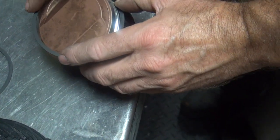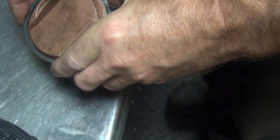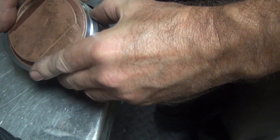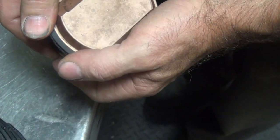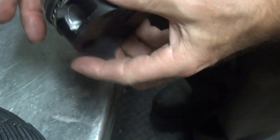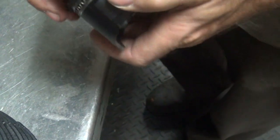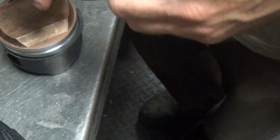So what you do is you put them in the groove over here, put your two thumbs on there, put your two fingers over here, and spread them apart — very gingerly. See how they're in the wrong groove? That means you're in the wrong spot, so you have to move them up to the correct groove. You're still pushing right here and you roll across that piston and now you're in the correct groove. Then I just come across with my thumbs, put a little light pressure, and pump them in. If you twisted the ring, it'll be tight and it won't slide easily — that means you screwed the ring up and you need a new ring. If you go too far out, you can snap and break them in half.